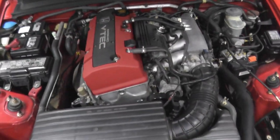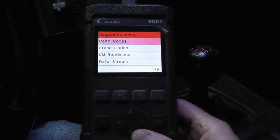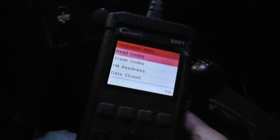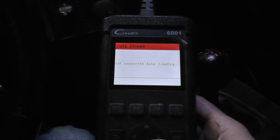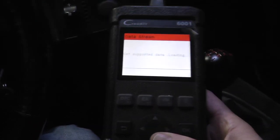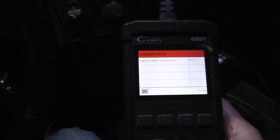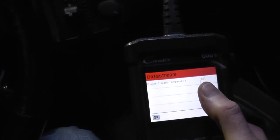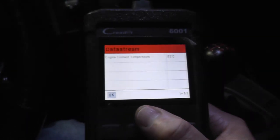Now let's check the heater. The cooling fans have come on twice, and my temperature is rock steady. If you want to go to the next step and really keep an eye on things, you can grab a code reader that's able to stream live data — this runs for around $40 or $50. I'll include a link in the description box below. If I go down to data stream and select items, we can find engine coolant temperature right here. Now we can actually see what the temperature is and use it as a baseline. For this vehicle, around 95 or 96°C is when the cooling fans turn on consistently.